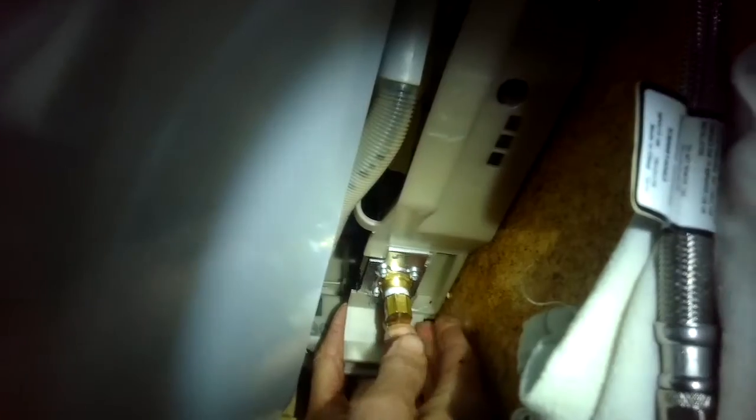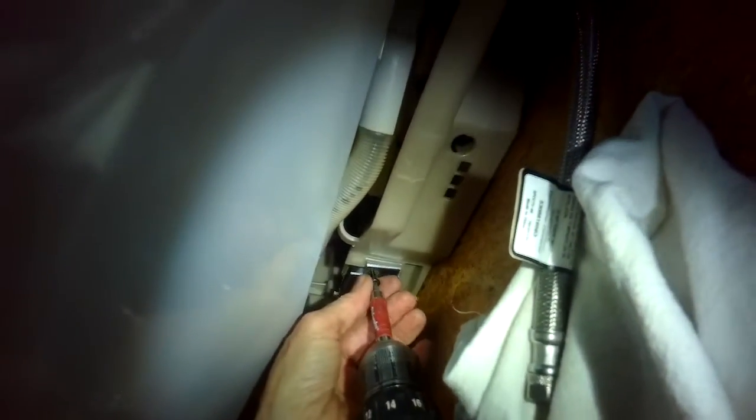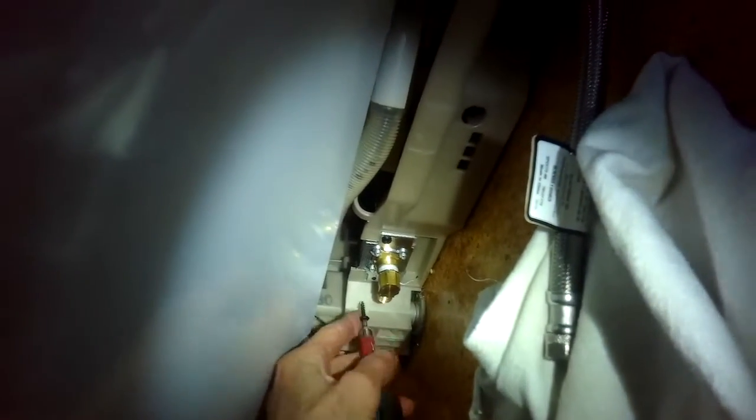We're putting the valve back into position. We're going to add those two Torx 15 screws back in, the black screws. And I have to turn that brass elbow a little further, 180 degrees further to the right in a clockwise direction because it's pointing the wrong way. And then once I do that, I can put on the hose. So I'm going to grab that thing with a pair of vice grips, turn it to my right until it points toward me to the right. And I'm going to put on the hose.